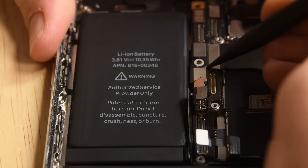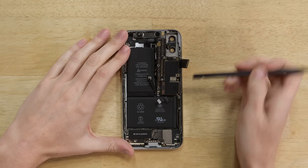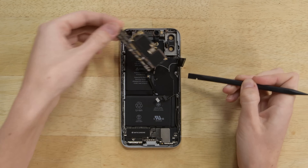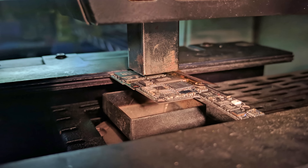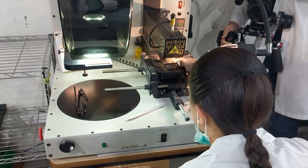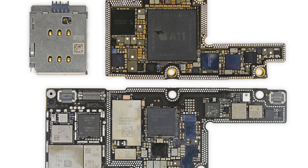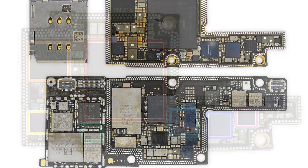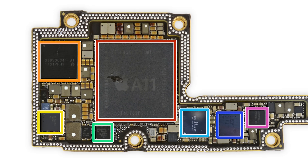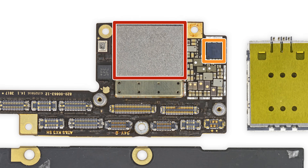Next out is the tiny logic board. This board is incredibly space efficient with a footprint of about 70% of the one in the iPhone 8 Plus. How did Apple put even more tech into that tiny board? By folding it in half, of course. The two halves are soldered together, so we got some help from our hosts at CircuitWise and their super legit hot air rework station to separate the layers. The iPhone X logic board is the first double-layer board we've seen in an iPhone since the very first one. On the boards you can see the 64-bit A11 Bionic system on chip, and on the outside of the logic board sandwich you can see the 64 gigabytes of Toshiba-made flash memory.